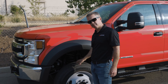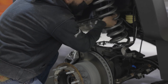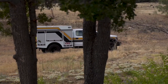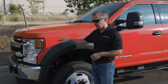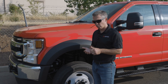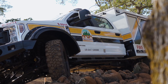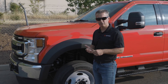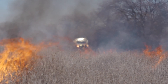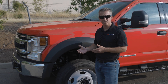This is the stock wheel and tire setup on the F550. We are going to be outfitting it with a Buckstop Super Singles kit. The Buckstop kit comes with a 3-inch lift, aftermarket wheels, and 41-inch Continental tires. We're also putting an aftermarket front bumper on. For a wildland application where you're off-roading, there are great advantages in terms of more sidewall on the tire, no rocks stuck in your duals, and fewer tires to maintain. The downside is they are expensive tires and they don't last that long.